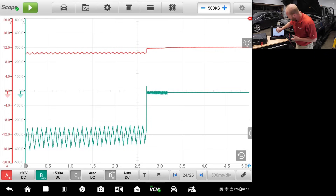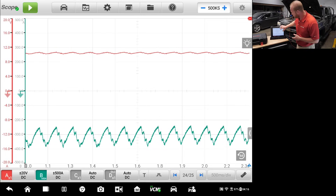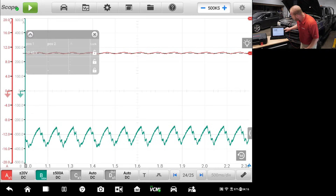I'm going to enhance the waveform by pinching to zoom and making it a little bigger. There's a lot of information built into this screen we can use to verify the engine is working mechanically correctly. We can also see how much voltage drop we have on the battery. Pulling down the red channel marker, you can see that while cranking on one battery of a diesel engine, our voltage dropped to 10.62 volts — still a really good result considering the amperage being pulled.